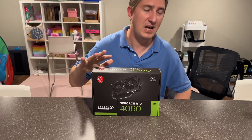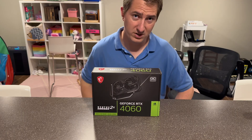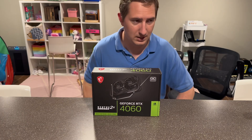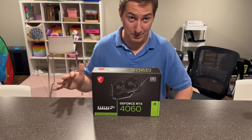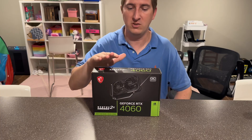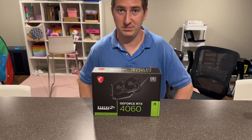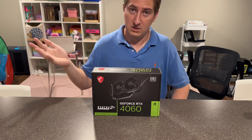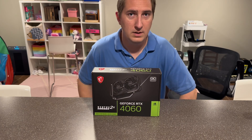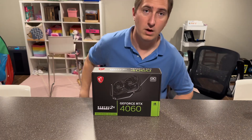Would I recommend doing this build? I don't know — I'd be a little nervous about the power, because it is only a 290 watt PSU in the Optiplex. I'd probably want to keep the side panel open, make sure there's proper ventilation, and I wouldn't want to do long gaming periods with it — just to be safe. I'd feel much better in, like, a Lenovo ThinkStation, for example, which is probably what I'm going to do next with this card. Other than that, it does work, so if you want to try it yourself, you surely can. Thank you all — leave your comments down below, like and subscribe, and I'll see you in the next video. Thanks, y'all.